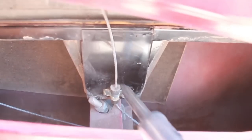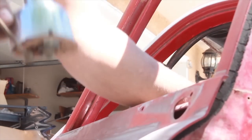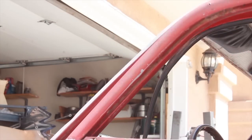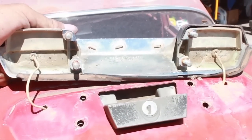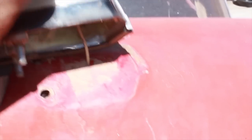Remove that screw and release this cable — there's the door handle. Once you remove that screw and another one a little bit alongside the handle, pull out the pin for the locking mechanism and then just pull everything out. For the rear tail lights, they're just four bolts from the inside to get access. And to remove the screen, if you ever need to change a light bulb, just undo the one screw on the side and that gives you access to your bulbs.